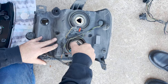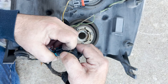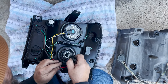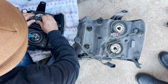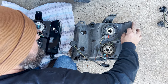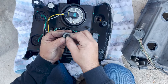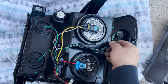This is your high beam — remember to the left. It's the one that only has the one clip. Take that and slide it right out of there, then put it on the new one. To the left pops it out. And this is just a little bulb — it just pops right out, very easy. Pops right back in. And that goes to the right. Put that back in there. We got our clip that we unclipped — just clip right back onto that.